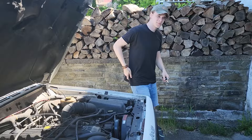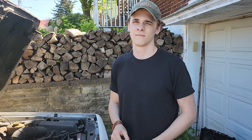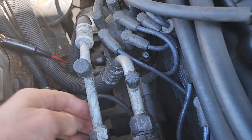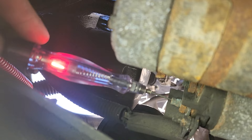Now people are going to want to see the result of that test. The engine's going to crank, but I'm going to show it real quick — I'll put the test light back on there to show everyone that that light should stay lit while you're cranking. To keep the car from starting, I'm going to disconnect the ignition coil. That way it cranks and doesn't start while I'm under there on the stud. Go ahead and crank it.